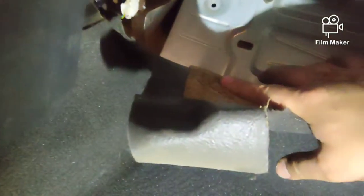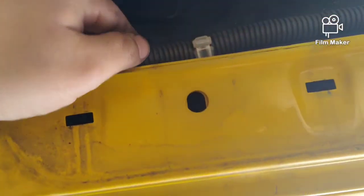So inside, you've got the kick panel, the sill plate. Those are already pulled. And let me get my light situated here so you guys can see. If you guys pull back the carpet, you guys can see there is a metal plate down here for the passenger footwell. Now I gotta still pull this panel off, and it's kind of hard to do one-handed. So pop this out, roll the carpet back, get to access the computer, and I'm gonna assume that this is my fuel pump wiring. I'll have to pull the back seat and go from there to get that out.